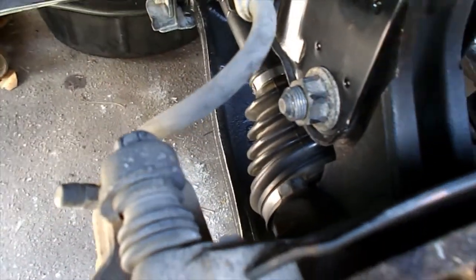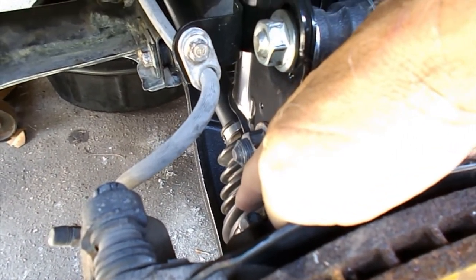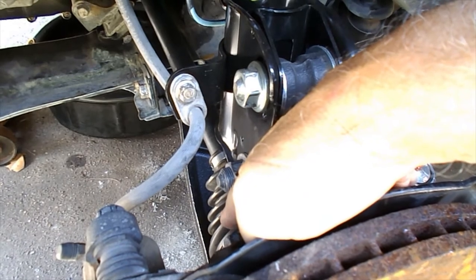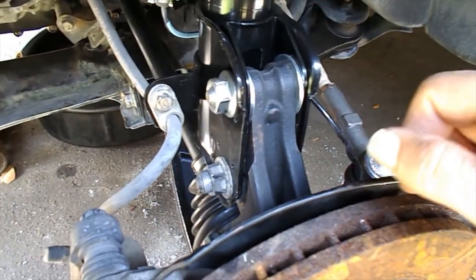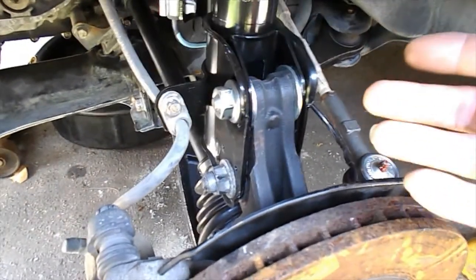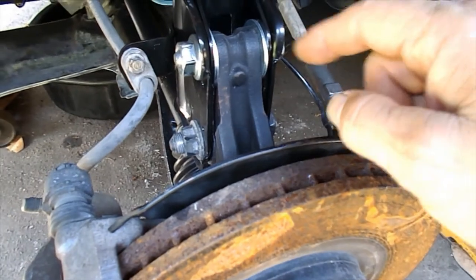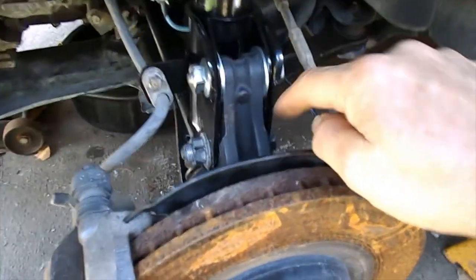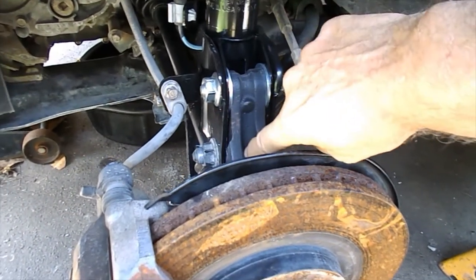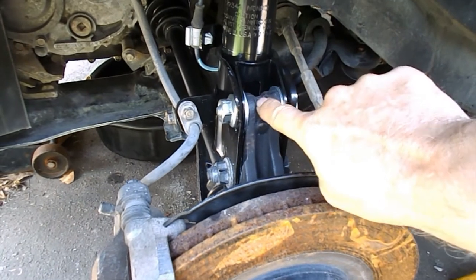You can see the TracMotive half shaft down there — the cup is smaller than a factory Honda Ridgeline shaft, so I'm not sure this modification would work with a factory Honda part since it's larger. On the strut, the lower bolt hole on the spindle had to be enlarged to accommodate the larger Ridgeline bolt. On the upper I left the spindle alone.